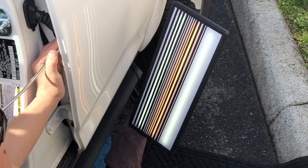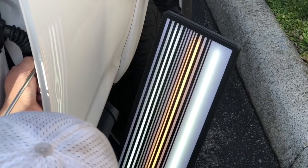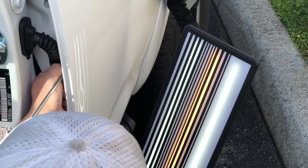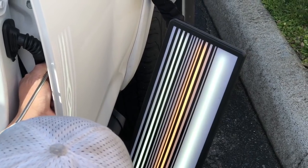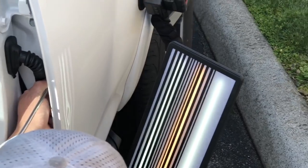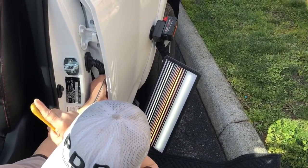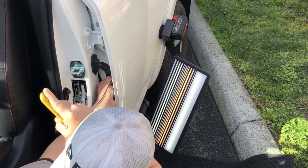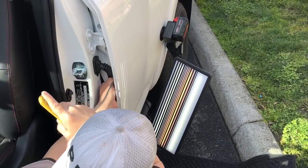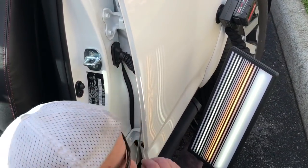Now I'm kind of hurting my fingers because I'm using them as leverage, so I might want to get a glove. I don't really want to pinch into that rubber — even though it's just a big piece of industrial rubber behind this brace, I don't want it to be marred or at worst chopped up. So we're taking our time going real slow. With this J-hook I'm doing basically a reverse pry — I'm prying but pushing forward to get that pry, and I'm twisting at the same time because my tip is stopping at the edge of the pry and I have to twist a little to actually get the push. It's super delicate down here, going real slow, and I might even want to get a little bit of heat. So let's make a stop.